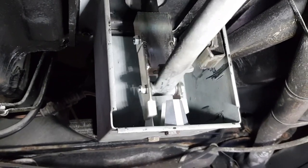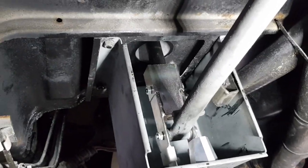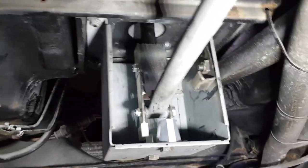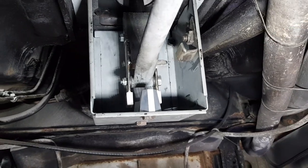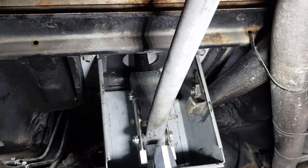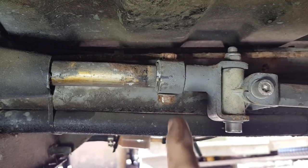For this end, it's catching on there so you can't get across at all. What we need to do is move it forward a bit so it's right in the middle. Luckily this lever automatically goes back to the centre, which makes it far easier - with the old lever you had to put in a block of wood to get the right positioning. I'm looking for just the centre position where it doesn't fall on that bracket. So nice and easy this end. That's where it used to be and now there's a bigger gap, so I'm now going to go to the gearbox end.